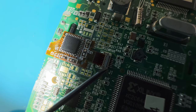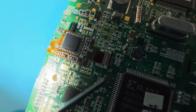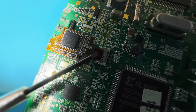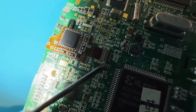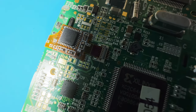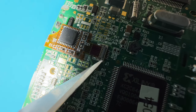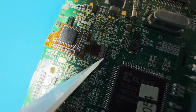It's this black thing on top, and it flips from this side, from the chip side, and open, so you can kind of lay your tool gently on the ribbon cable, go under the black in front, and just kind of flick up, and it'll flip open. I'd like to move this to show you it can move. There you go, see? Anyway, so there, that's open.